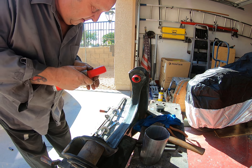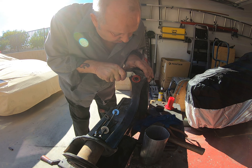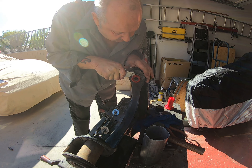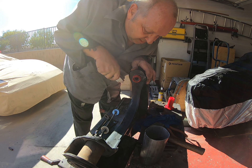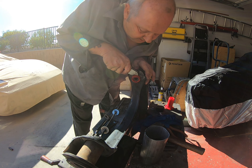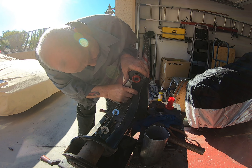I have inserted the first new rubber bush - but it's not rubber, it's polyurethane. It would appear to be a lot longer than it really needs to be. So out with the trusty Stanley knife - or utility knife as you Americans call it - and I'm going to trim this off level with this edge because I think that's the right thing to do. I've left it sitting in the sun so it can squeeze its way through. I like it to be level and neat.